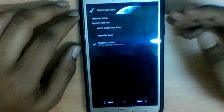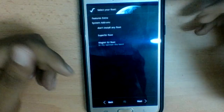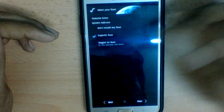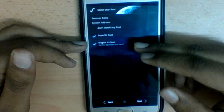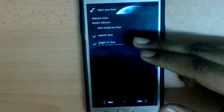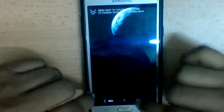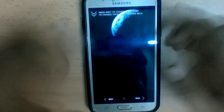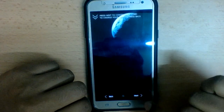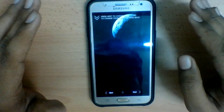Next, it asks whether you want to root your device. It's better if you do, because you get many more features. There are two root options: SuperSU or Magisk. I was using Magisk but honestly it doesn't work well — it's basically useless. I'd suggest SuperSU. After that, select Next and the custom ROM will be installed automatically, then you can select Reboot to System.